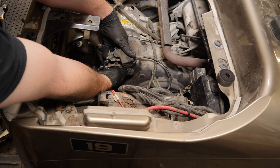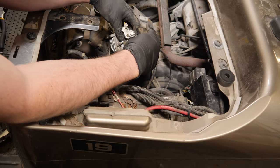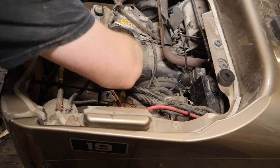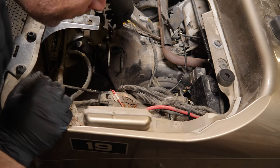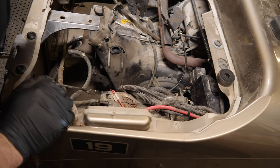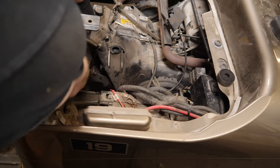There's also this anti-tamper bracket that has the choke on it. What I like to do is pop the throttle linkage off, slide the carb off, and then rotate and flip it around a little bit to get the choke cable off. Set your carburetor aside. I might actually clean this carburetor since I have it off — I might as well. Also noticed they gave this thing the wrong shaped gasket. Now the intake stuff is all out of the way.